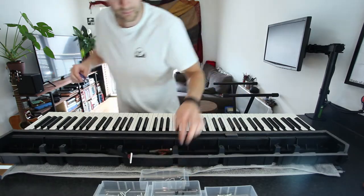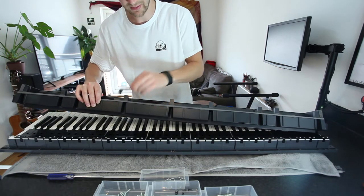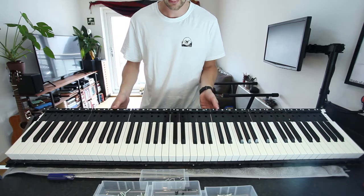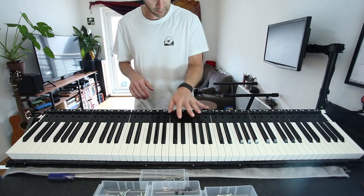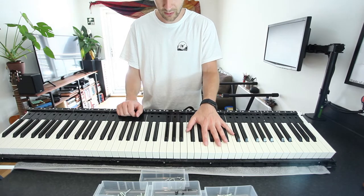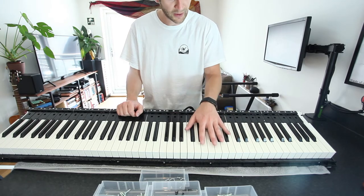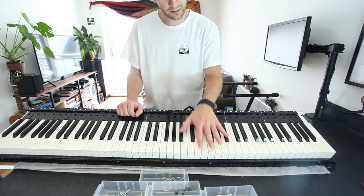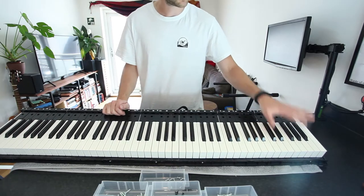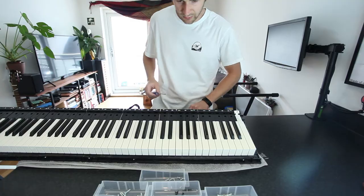Small screws with these ones. That panel's out — so that should just lift off. Right at the edge here there's another wire, so just be careful you don't snag that. Each keyset has a module here and they look like they're in octaves, with three screws per octave. The problem here was on this octave. When I opened it last time I figured out what was going on — it wasn't dust, it needed a replacement part. What I found is I could actually swap that part with another octave, so I just moved the problem further up. I did make the problem worse but that's fine because I've got the replacement part now. So I'm going to open the top octave and swap that part and show you, since the G is fine right now.